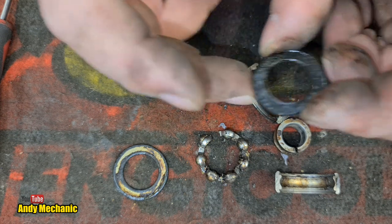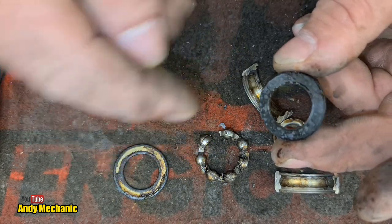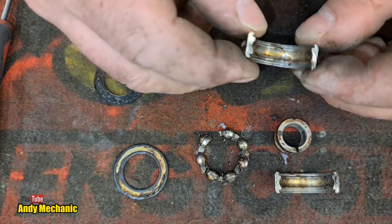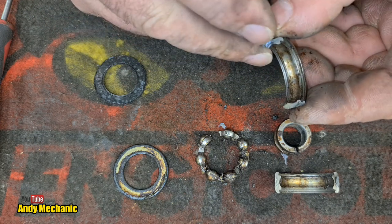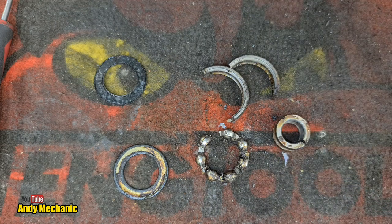So this will be the point of least resistance, and the expanding air inside the motor, the heating up air, would have passed through this bearing and carried with it some of that varnish, and that varnish has then settled on the races and caused the bearing to seize up, which in turn would have added more resistance to the motor trying to turn, and the demise has begun, hasn't it? That's it. Game over. I do like these autopsy videos. They're brilliant. Every one tells a different story, and you never know what to expect until you start pulling the whole thing apart.